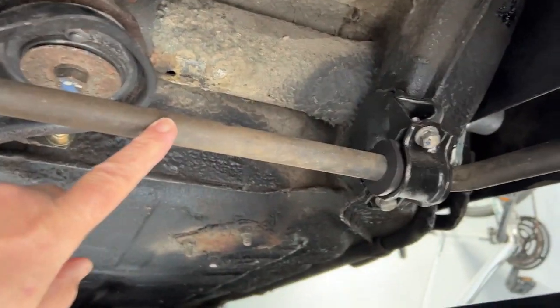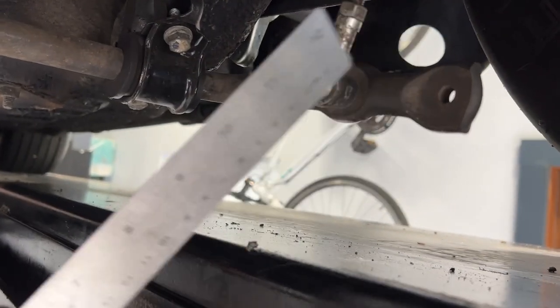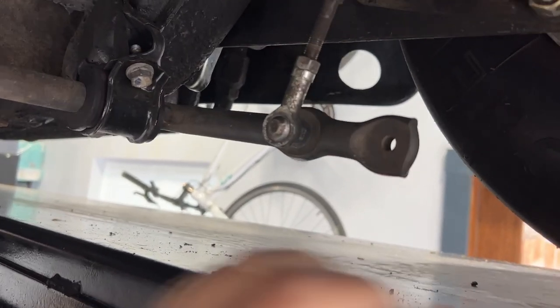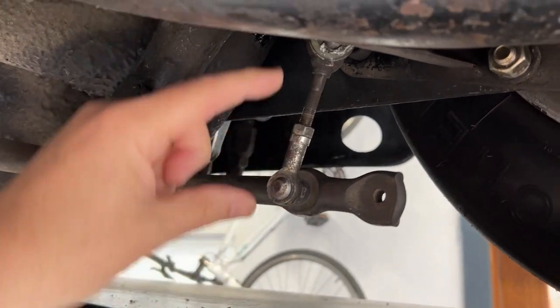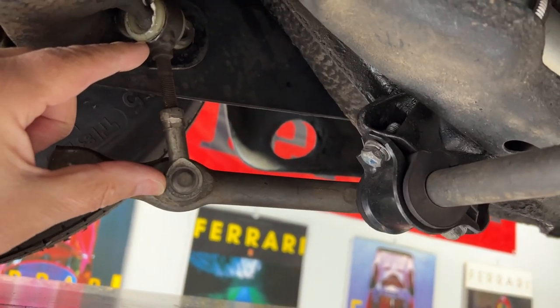Today we are going to make a small adjustment on the stabilizer bar, anti-roll bar that we have here. This is the anti-roll bar. It's actually the low point underneath the car — it's about two and a quarter inches. It's adjustable, you can do this location or this location. What I want to see if I can do is loosen this and reduce the length of that linkage, and do the same on the other side so that it's doing the same job but it's higher up.